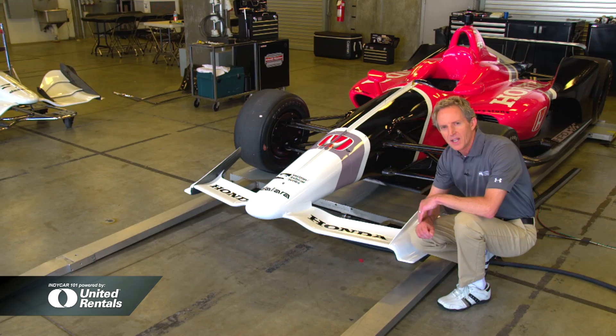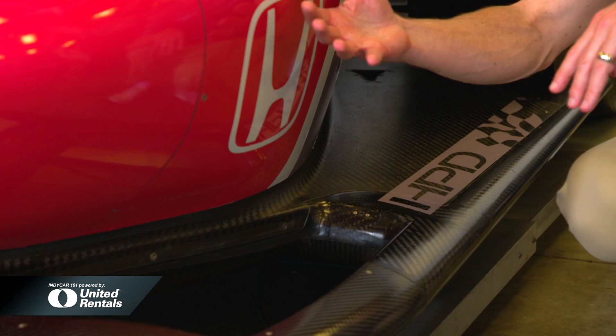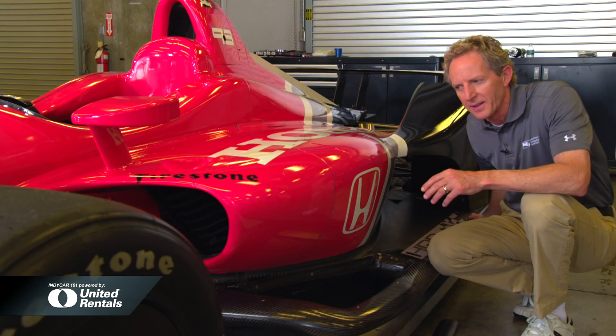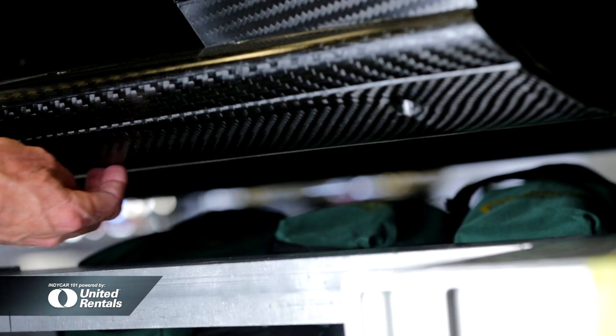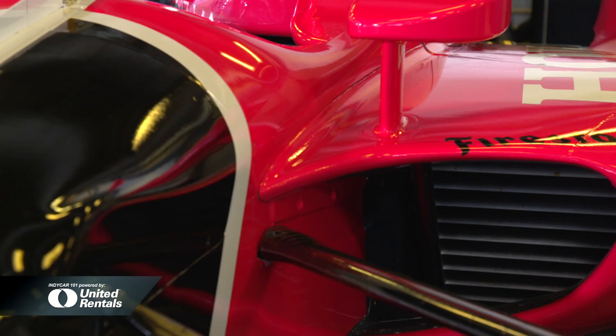You may not have to rely on the front wing as much, because underneath the car, the domed skid has been removed — that lowers it by three-eighths of an inch — and the domes are replaced by lateral domes on the outside edge of the underwing. The combination of those two adds 6% to the underfloor downforce.